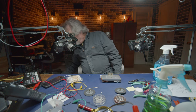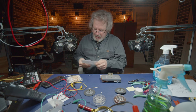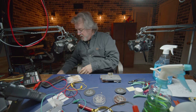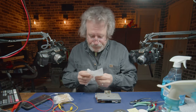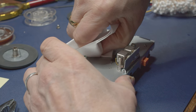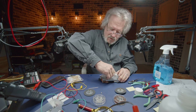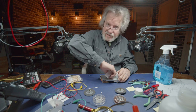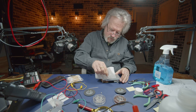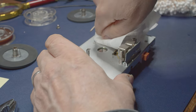The contact between that motor shaft and those rubber reel tables - that's where the rubber meets the road. You cannot put any lubricant on that motor shaft because it will slip. Cleaning the reel shafts now. The Q-tip isn't going to fit through that hole, so I'm going to peel off about half of the cotton, put a little alcohol on it, go in there and squeegee that off, rotating as I go. With the wooden ones, I just break the tip off so it doesn't recontaminate the inside.